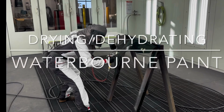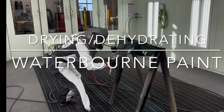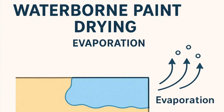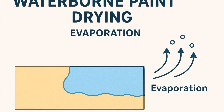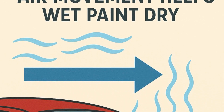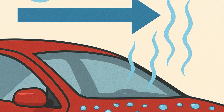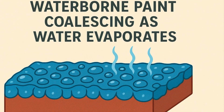Welcome to this video where we will discuss the drying of waterborne paint through dehydration. Waterborne paint dries when the water in the paint evaporates, which is the dehydration process. As the water evaporates, it must go into the air around the paint, but the air can only sustain so much of the water, so air needs to continually move over the paint job in order for it to dry properly.